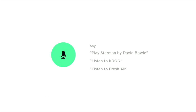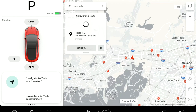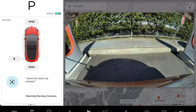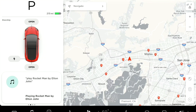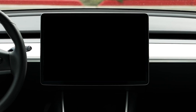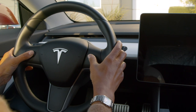Press, release, and then say a command once you hear a chime — for example, 'Navigate to Tesla headquarters' or 'Show the backup camera.' You can also tap on the touchscreen for voice commands. To resolve uncommon issues, press and hold both steering wheel controls until the touchscreen turns black, then lift off the controls and wait a few seconds for the screen to reset.